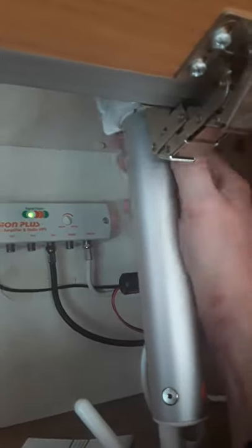How you get a good signal is to loosen the nut on top of the aerial, push it up, and turn it. There's a wee switch here to switch it on and off, but you can just leave it on — it goes off with the van. Just in case somebody switches that by accident and you're wondering why you have no reception. There are extra outputs here for if you want to put on an extra TV. At the moment we're running one TV but there are two spare outputs. Once you pull your aerial down just lock it back up again. Under the passenger seat you'll see your jack, wheel brace, and leisure batteries in that box — there's plenty of room if you wanted to fit an extra battery.